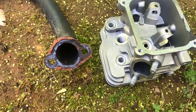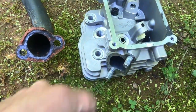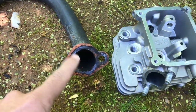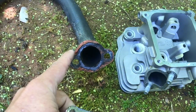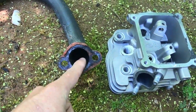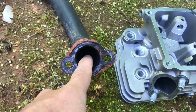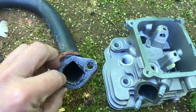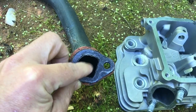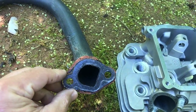Something else people miss quite often: we ground our gasket down to match the head diameter, but a lot of people don't think about their exhaust. A lot of aftermarket exhausts come with just a plain round hole, while your head port is not round. So I also gasket-match the exhaust, just to make sure we're not trying to force that odd shape into a round hole — that'll help the flow as well. Luckily, on this exhaust the hole is just so big there's no metal sticking out past the gasket, but I'll double-check it before we put it back on.